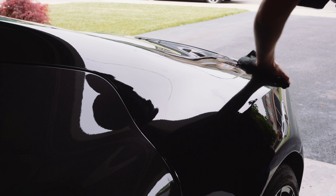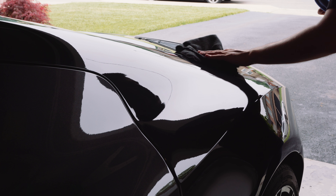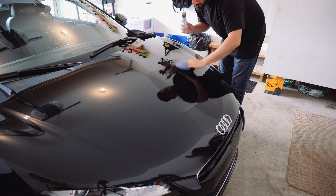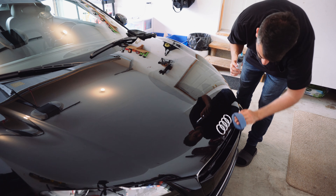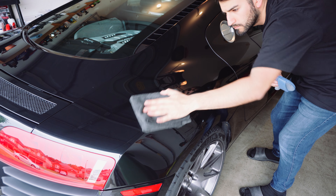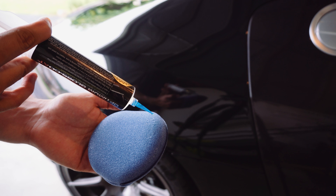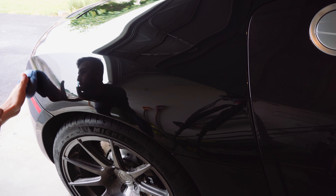Once you've applied that section and given it a buff, the ceramic coating is on there — you're good. It's super easy to apply; a lot of people ask if ceramic coating is hard to apply, and the answer is no. It's actually super easy and straightforward, as long as you follow the instructions and do one section at a time. Repeat that across the entire car. Optimum says not to put this on glass surfaces, so I didn't. I applied it to all the painted surfaces, on the 3M PPF film, and on the wheels. It took about an hour to apply to the entire car. One learning: you don't need that much product — 10 to 12 drops per section goes pretty far.